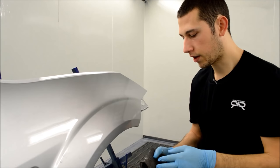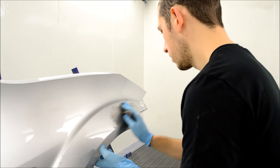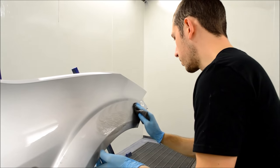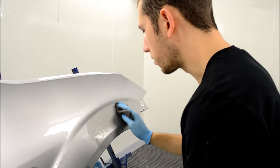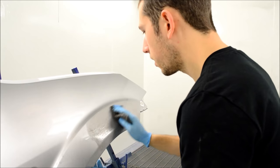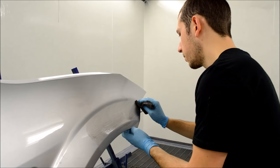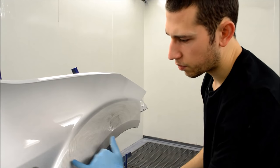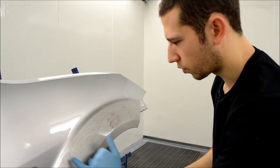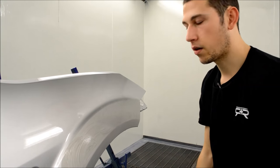I've got my grey scotch pad with some prep and blend paste on it, so all we're going to do is go over the area where we're going to do our fade out. Because we're going to put our J-tape's no-edge blend tape along this edge, we need to make sure we've scotched right up to that line. Don't go too far over or under, or we're going to get lacquer peel or a horrible edge we can't polish back later.